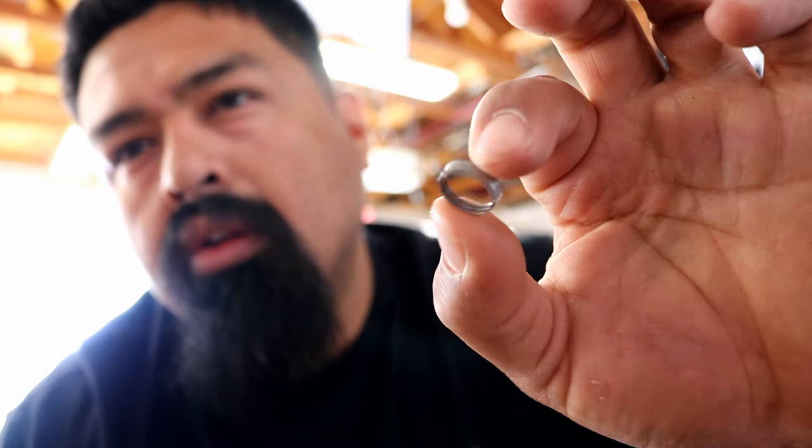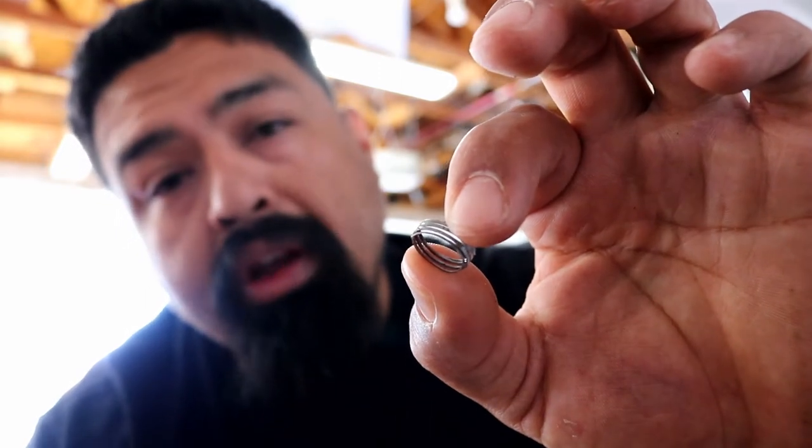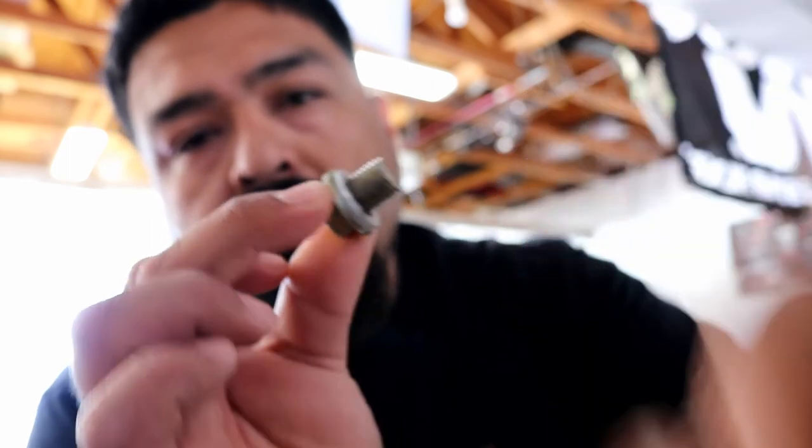This is a piece of the oil pan — the transmission oil pan for the Civic. I stripped out the drain bolt. So right now I have a bolt coming in online — it's an M14 by 1.5 oversized bolt that's supposed to be slightly bigger and bite into the aluminum oil pan. Since it's aluminum it should be relatively easy to fix. I'm hoping that fixes it; otherwise I'll re-tap the oil pan. Right now I have the oil off the car, waiting for that bolt.